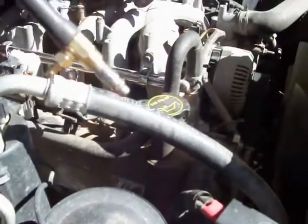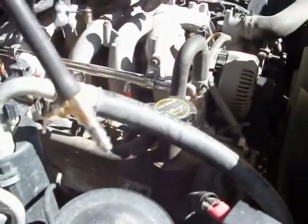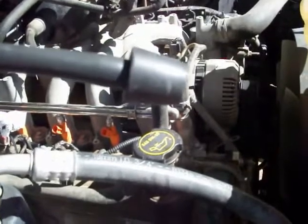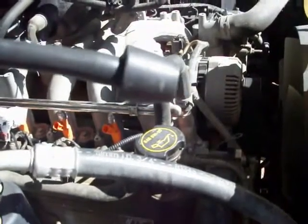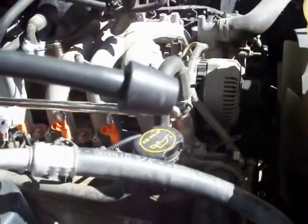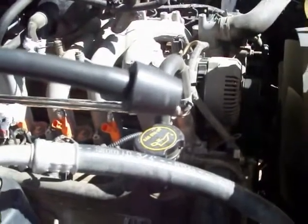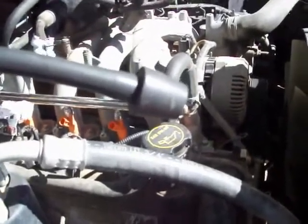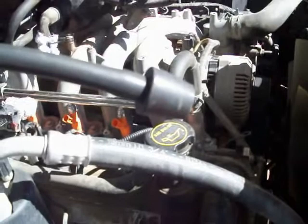You hook up your air compressor, put in a little bit of air, just turn on the valve a little bit, and it pressurizes up this hose up to this little stopper. You shove the stopper down into the spark plug hole, get it kind of sealed, and then turn on a little bit of air. If the valves are open, the air will go inside the cylinder, go out the open valves, and either go back up your intake or out your exhaust — you're going to be losing air if any valves are open.